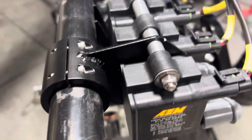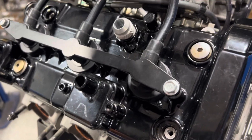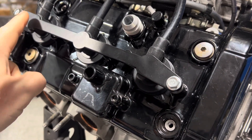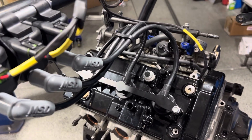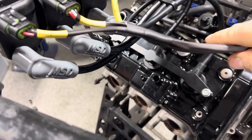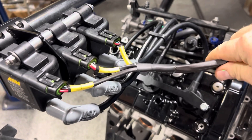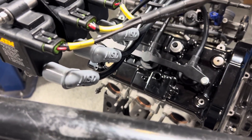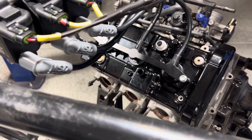Our kit consists of the bracket that mounts to your frame, and the plug-wire hold-down, which uses the two outside fasteners that were originally holding your outboard bolts and coil packs. That comes with the prefabricated modified Honda B-series wires and the plug-and-play harness. I'm going to change these labels — the label size needs to be smaller and I'll probably go white instead of yellow, but small detail. This gives you the idea of what this is. You get your three coil connections and the nice harness here.